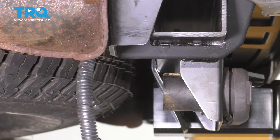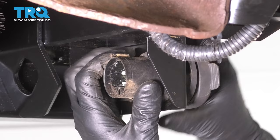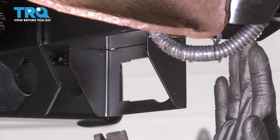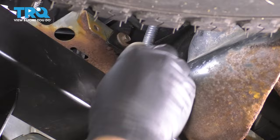Now let's get this plug out of here because our new one comes with a plug, so we'll replace it. To do that, there are two clips — one on the top, one on the bottom. Sometimes you can pry them with your hand, other times you might need a little pry bar. If this is rusty and corroded, it'll be fairly stuck in here. It looks like ours came off nice and easy. And from underneath, you can see where the wiring harness connects to the hitch — just a little plastic retainer.